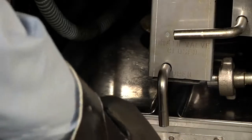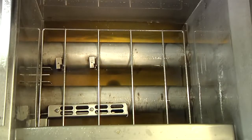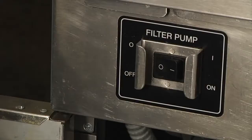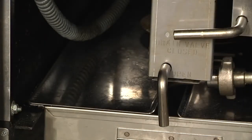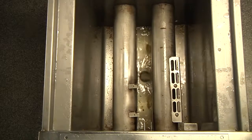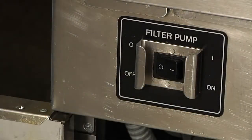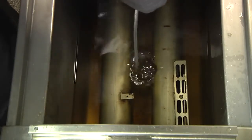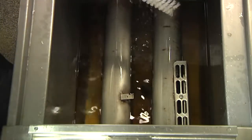Remember, the oil is very hot, so use extreme caution and make sure you are wearing all safety equipment. Remove the basket rack. Turn the filter pump on with the drain valve open. This allows the oil to flush out any crumbs from the fryer to the filter pan. If the drain valve becomes clogged, turn the filter pump off and, with the straight brush or clean-out rod, dislodge any crumbs from the drain valve. Be careful not to damage the interior of the drain valve.